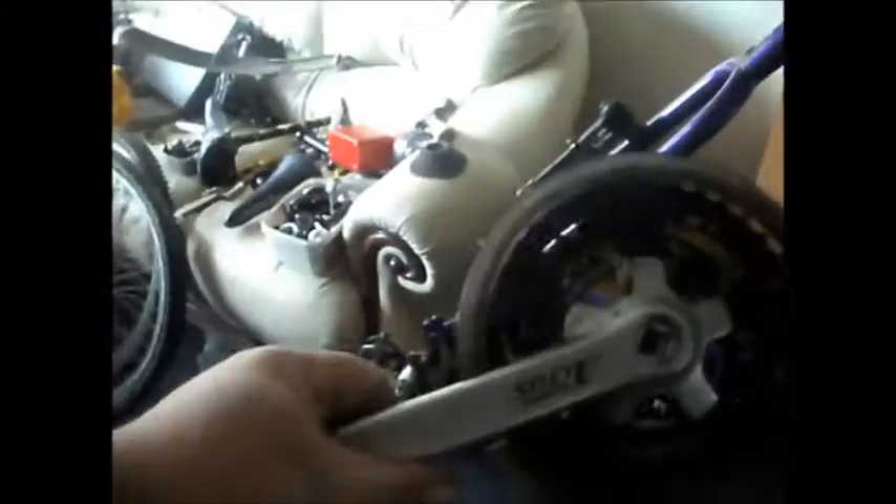I'm back. The crank is now off. There it is. Apart from looking a little bit rusty and dirty, that'll wire brush up fine. Teeth are okay — there's a couple of short ones there, but that shouldn't affect the crank. If there were more short ones like that I'd change the crank, but I think I can get away with it. So that's ready for a clean up.